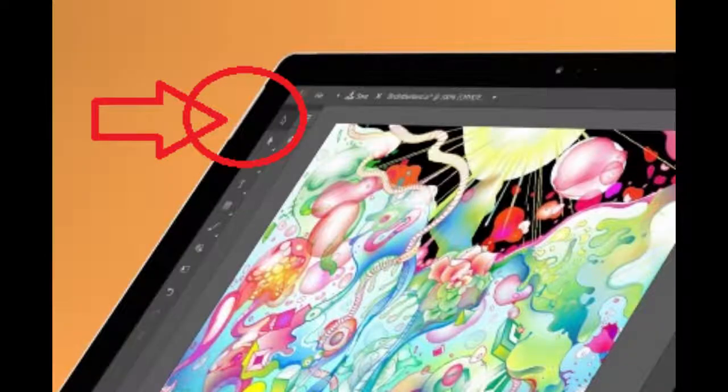Wait 15 to 20 minutes and try opening it by sticking the pick into the small gap between the back of the Surface Pro and the front of the Surface Pro, aka the screen. It should glide through the screen with relative ease, even though you might come to some tricky sections.